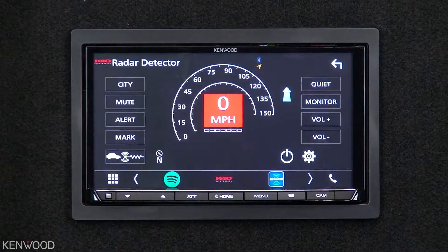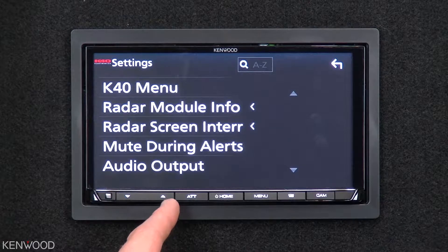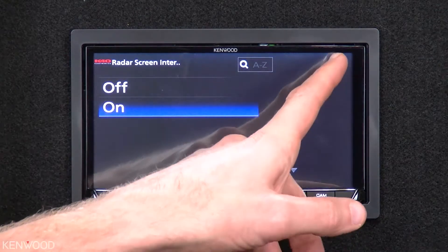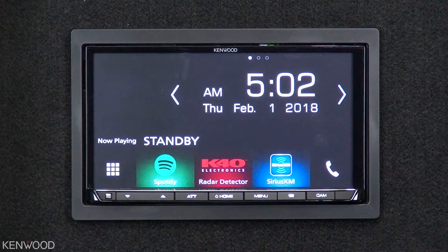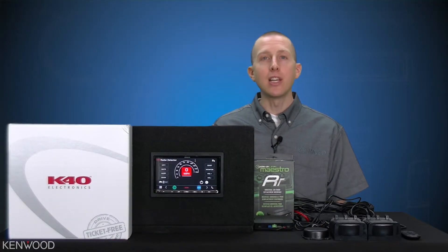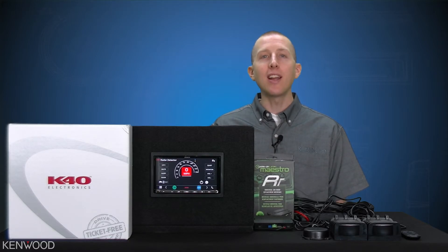Let's take a look at the K40 radar detector settings screen. When you enter into the settings, you will see there is something called radar screen interrupt. Let's go ahead and select that — you do see it is currently off. Let's turn that to on. Now, if we exit back, or you could just press the home button to go to the main screen, let's take a look at what happens when I press the radar gun now. You see that instantly it changed to the K40 source screen, and now it goes back to the home screen automatically. Thanks again everyone for tuning in to the unveiling of the world's first aftermarket stereo radar detector integration. We'll look forward to seeing you again next time.